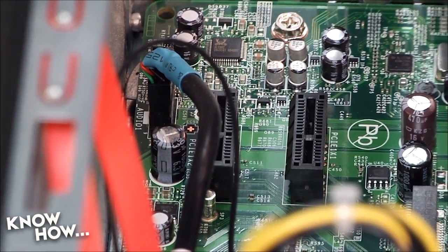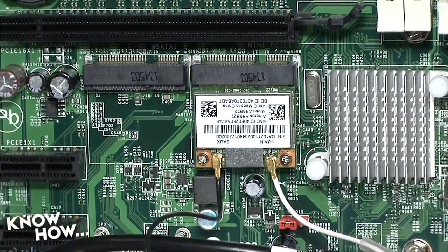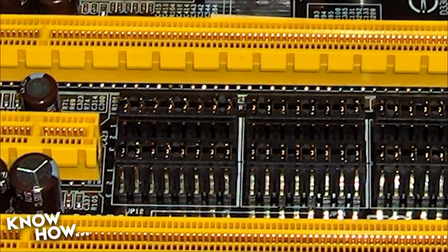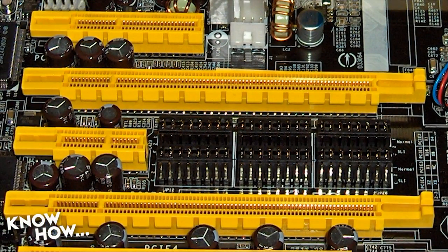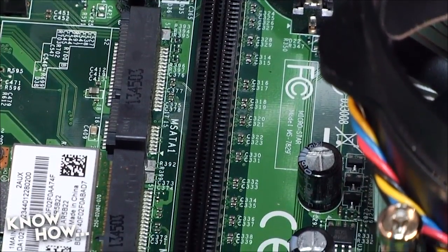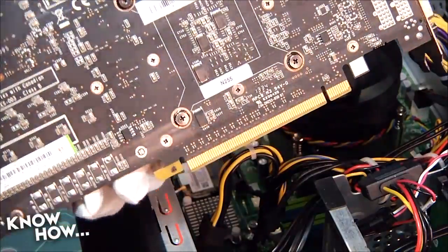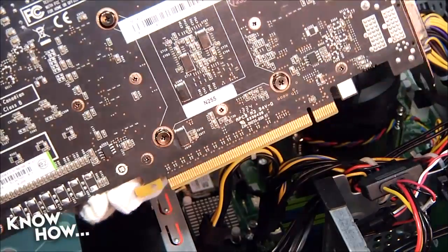The Predator has one PCI Express X16 slot and two PCI Express X1 slots. The X refers to the number of lanes in each PCI Express expansion port — the higher the number of lanes, the more data packets can be transmitted simultaneously. PCI Express slots can have 1, 2, 4, 8, 12, 16, and 32 lanes, with 1 and 16 being the most common. You can tell how many lanes a PCI Express slot has by looking at the size — each lane adds 4 wires to the slot. Video cards work best when you give them PCI Express X16 slots. You could run a video card on an X1 slot, but as your goal is to go faster and not to cripple your brand new and probably extremely expensive upgrade, that would be stupid.